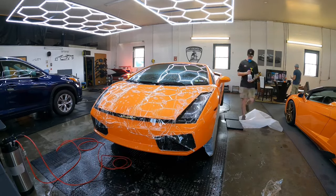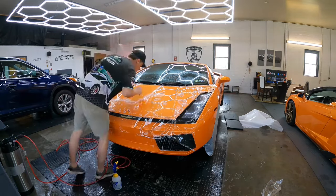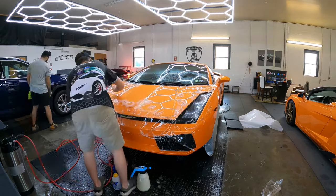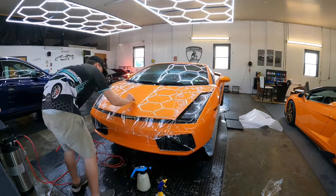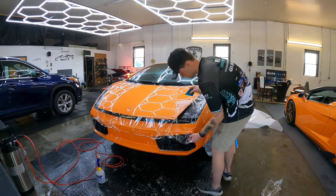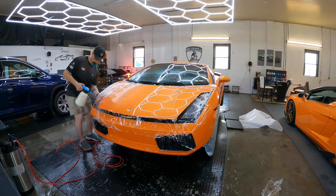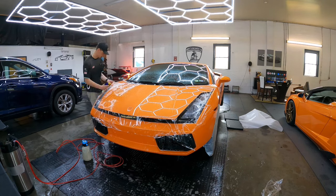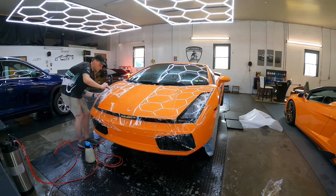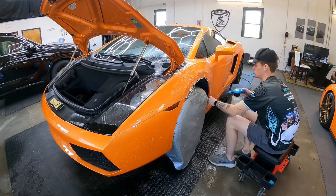The first thing to attack — and it's pretty common — is all of the indentations or valleys which may hold air or moisture. Go after them first, then hit the flat areas next. He's working the center, then he'll work towards the edges. We squeegee out the slip solution, which is a mixture of surfactant and water. Even after squeegeeing, there may still be some moisture or an air bubble or two that you can attack later.